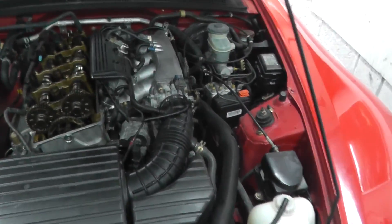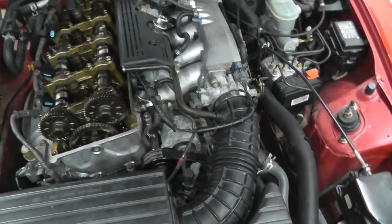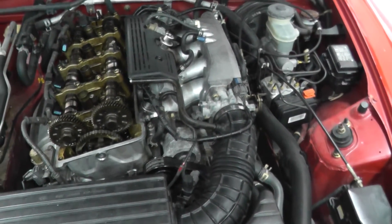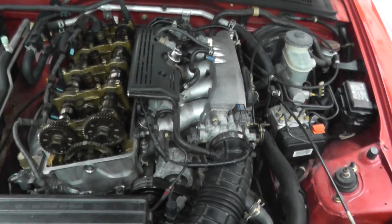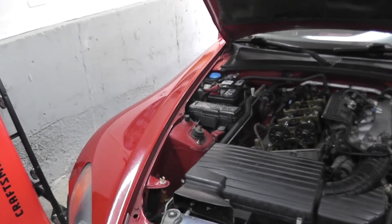You may have to do an idle reset. A great tip from Scotty Kilmer: if you just start your vehicle, turn on the air conditioner, and let it run for a few minutes, the vehicle will often learn the idle reset on its own — and it does work for many vehicles. So that's all it takes to test, and if you have to replace the throttle position sensor, it's really not a hard job at all — you can complete this at home. I hope this helps a number of you save some money and keep your car going. Until next time, thank you for watching.